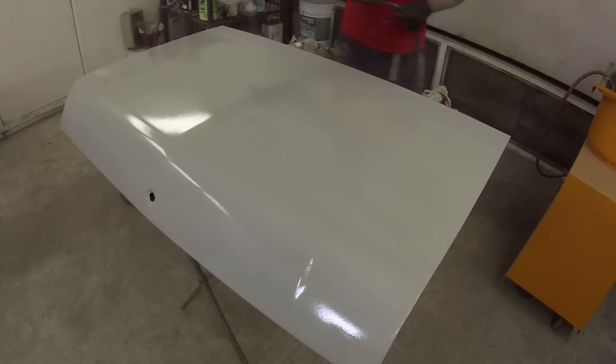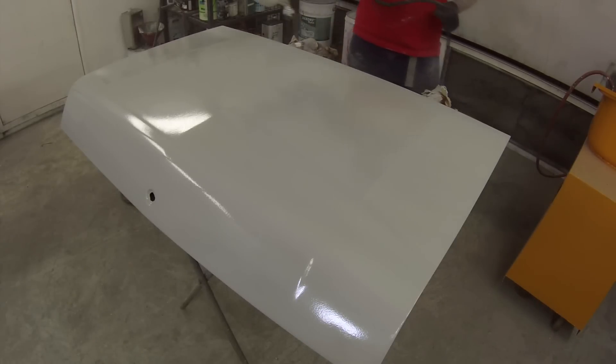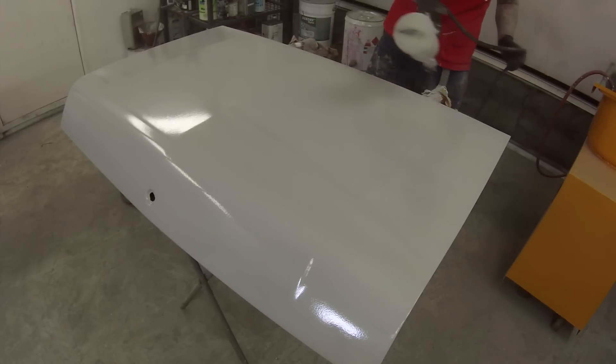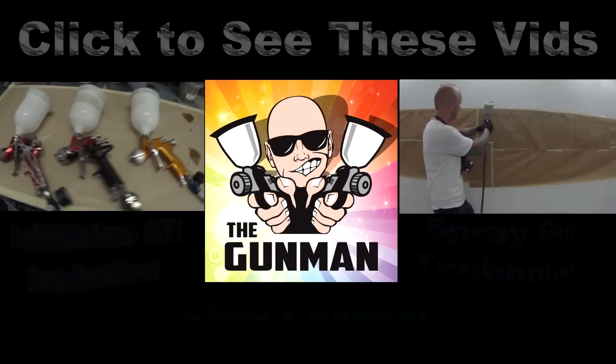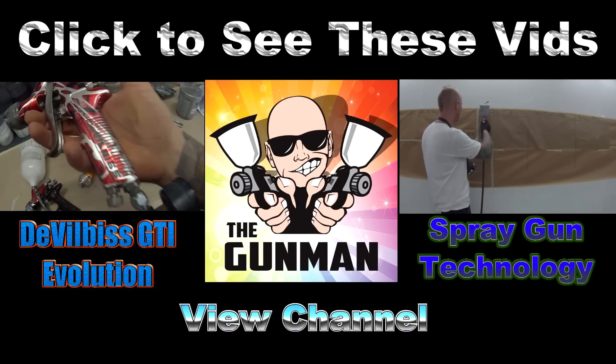This is the Airgunza AZ-3 I mentioned — I'm going to give you guys a look at it. This is exactly the same primer, same thickness, and it's just breezing through, getting it on a lot wetter and a lot nicer. So for a primer gun, I wouldn't go for the FLG670. However, wait up for the following couple of reviews and demos — don't give up on this gun yet. That's it for this review and demo. Thanks for watching, and this has been another Gunman Production.